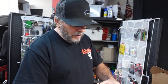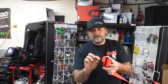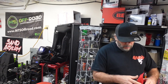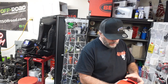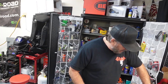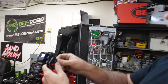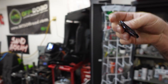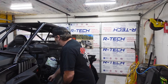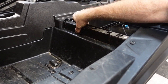The ends of the shoulder harnesses on these Simpson D3s have these plates in case you're going to bolt them in. We're not bolting them in — we're wrapping around the bar back there. So we're gonna swap from the clip-in connector because we're gonna bolt this. We don't want to clip-in for that hold-you-in-your-seat portion — we're gonna bolt it right here and connect up. Good plan.